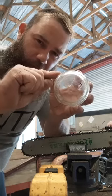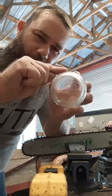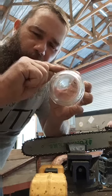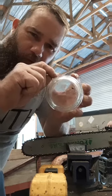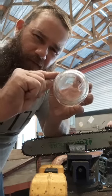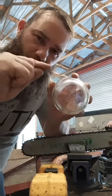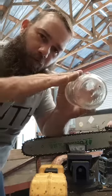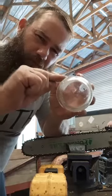You can look and see the same thing I'm looking at. If you come on up, it's going to make a real thin edge, which you would think would be sharper. For one pass, it might be. But all that's going to do is fold over. That's going to fold over so easy. So that's why they say this, because you're getting the right angle on that cutter. All that is a plane, like a plane in woodworking. Every tooth is just a plane. Like if you was doing woodworking and you was running that plane over it, it's just a plane.